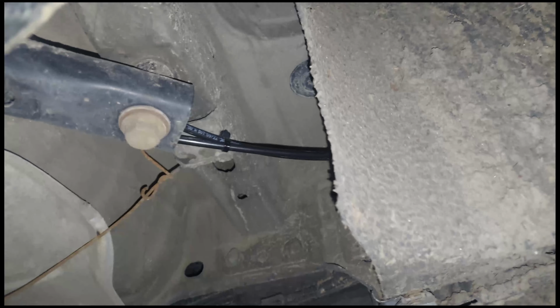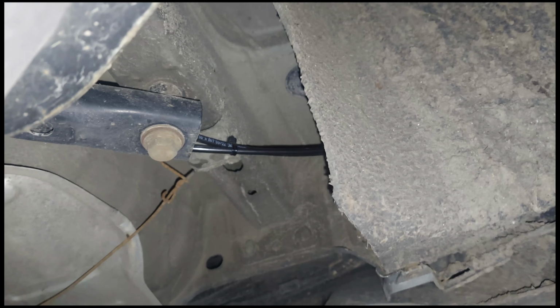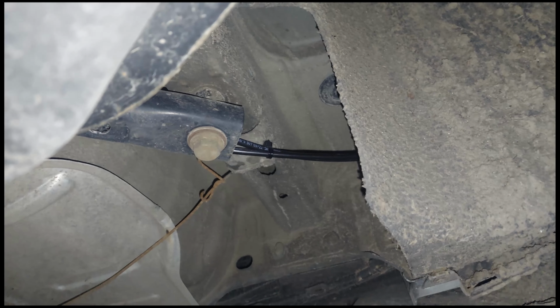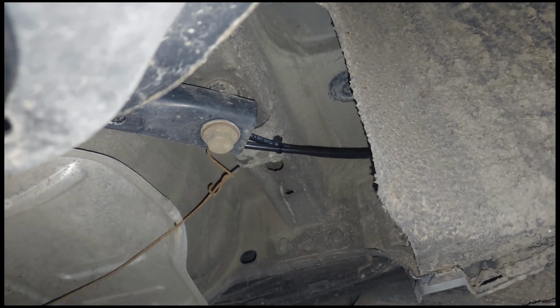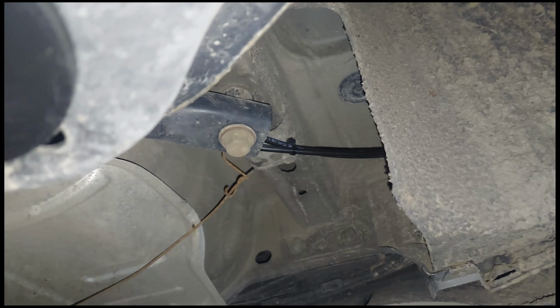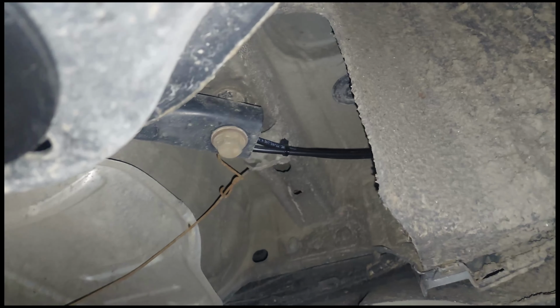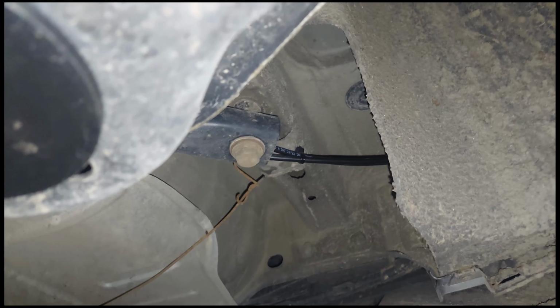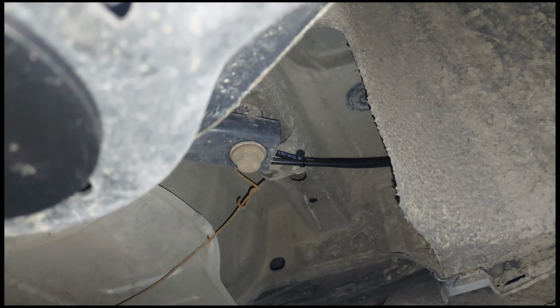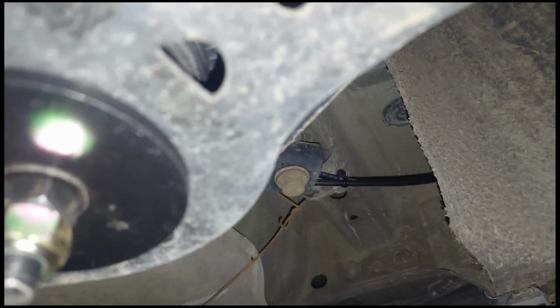That's another thing. A lot of kit suppliers will give you like 60 feet of line. 60 feet of line is cool for a small car, but if you're running a large sedan, it's a lot longer. It should last you, but there have been many instances where it's just enough to run your lines into the sides, but not enough to, for example, have an extra line running from your manifold to a purge valve or anything like that. So pay attention to that.